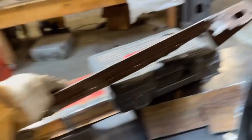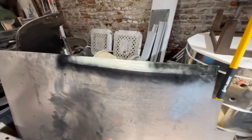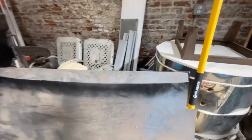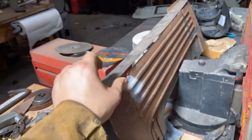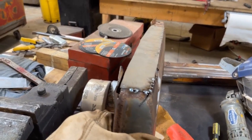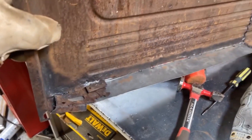Now I've got to start figuring out the actual geometry of this bottom flange. I have that door bottom chucked up in the vise with a mask applied that I'm going to remove and use as a template. If you've been following my channel, you know my favorite way to transfer marks is with spray paint — you get the exact mark without any real error, as long as you push down hard and get a good seal. We've got this bottom piece cut out. Because these are mirror images of each other, all I've got to do now is flip this over. Tack welds are in place and this is actually looking okay — got the crown where I want it and the straight edge along the right. I almost bought a replacement panel for $300 or so, but one day of sweat equity — getting there.